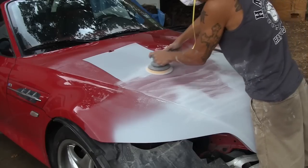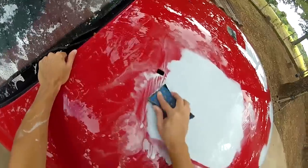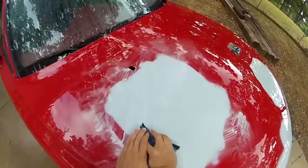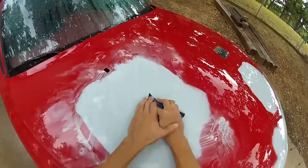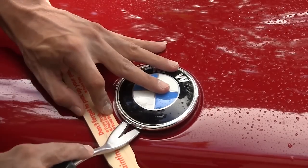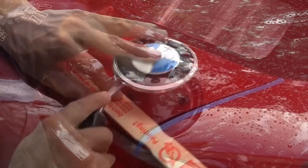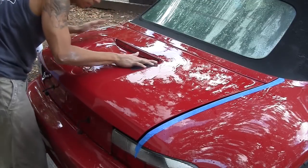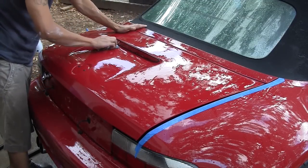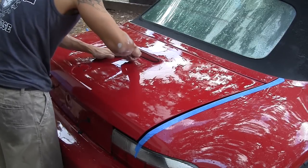There was a point where I used to do a lot just by hand, and the job comes out really nice. What I'm doing right here is finishing by hand because you can feel all the little imperfections with your hand. I'm using an old piece of 400 — very smooth by now — to wash the quarter panel down because that's where we're also going to blend. Here I'm popping off the rear trunk emblem because we don't want it on there. I was only going to paint the top strip but I decided to do the whole trunk because there were a couple of imperfections there as well.